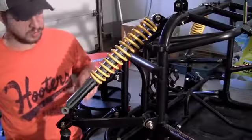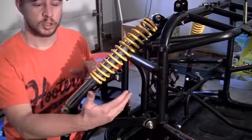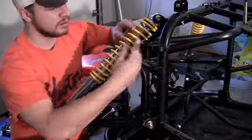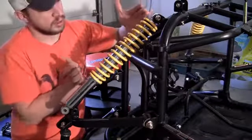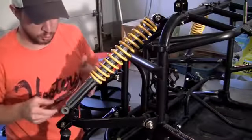So we have a couple of options here. First, they sell a tool called a strut compression tool. What it does is it takes these coils and pinches them together, and whenever they pinch together, the piston can shorten — that little cylinder can go back into the piston — so your entire strut shortens.